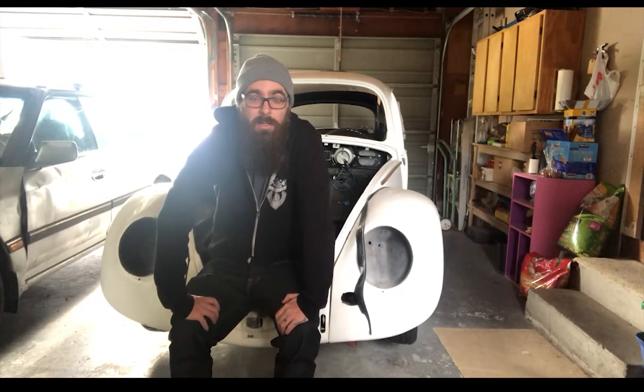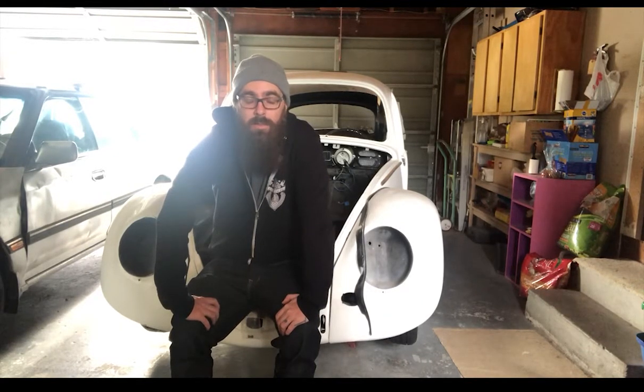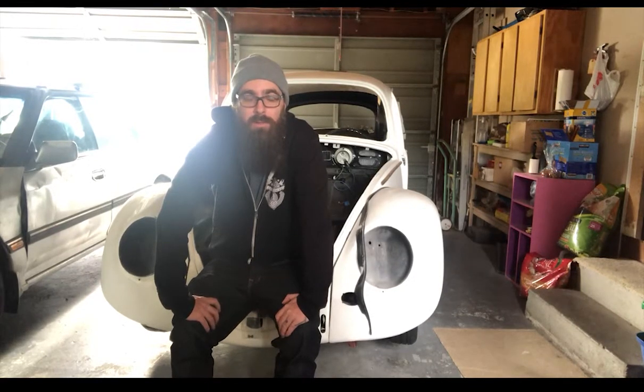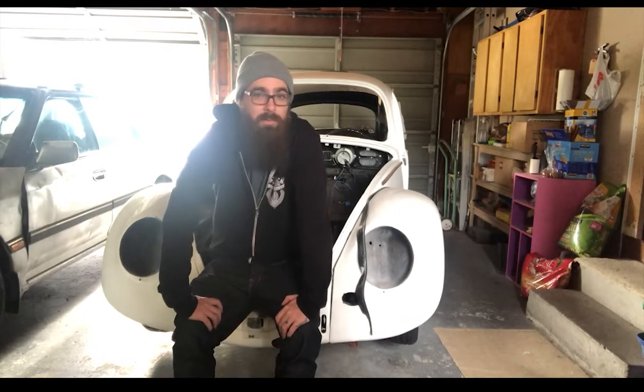With the new beam, I decided to go with shocks on it. It's a ball joint front end — it's not going to be stupid low, so I might as well have shocks on there. I got extended and notched spring plates for the rear. Once everything's dialed in and the full weight of the car is in it, I'm probably going to have to readjust the suspension anyways. I also have to redo all the wiring — I wasn't happy with the connectors being all old and crusty. That was a big consideration when going through and redoing this car for the second time since I've owned it.